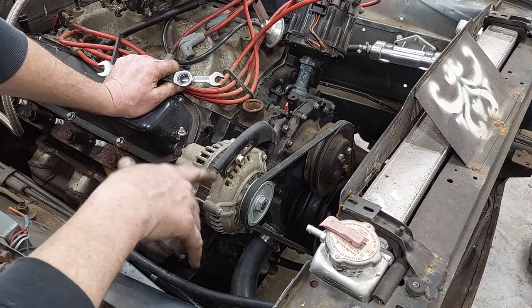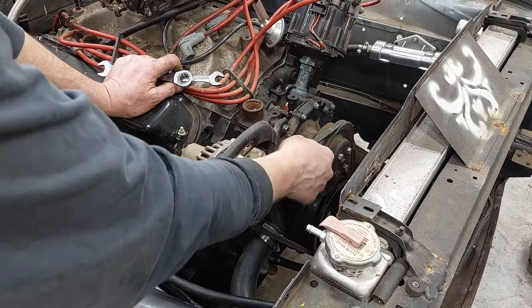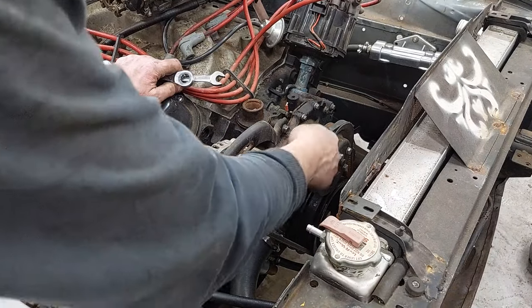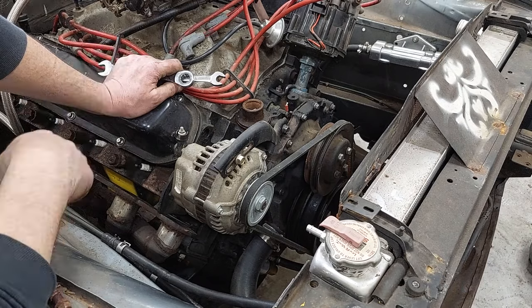It's not gonna slip, it's not gonna burn the belt. There's not a whole lot of tension on this alternator — this is going like a 55-amp alternator, so it's not going to draw real hard. It's not going to put a lot of torque or resistance on this belt, so it ought to spin freely like that, and I think that's good.